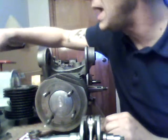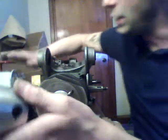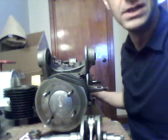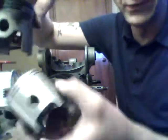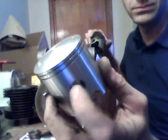So that's it — that's a bit of it. Basically, if you have a regular size barrel and you want to use the Wiseco piston on a standard barrel, your choices are to either swap the crank out to give you the extra height, or shorten the barrel. Then you end up with a short barrel machined version with this piston in a standard Li crank. Hopefully that made some sense and answered some questions. It's basically all about getting this height off the base gasket correct. The TV-175 would look very close to the short piston because it would actually have a 32 millimeter crown height. Hopefully that answers some questions — we'll see you guys around.